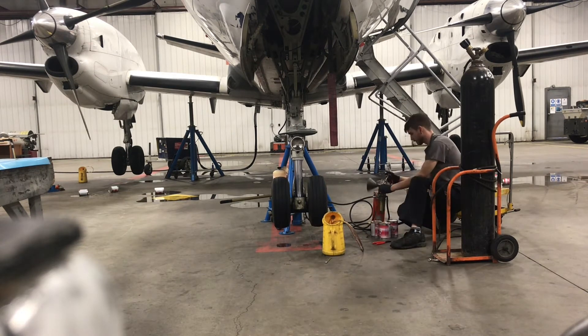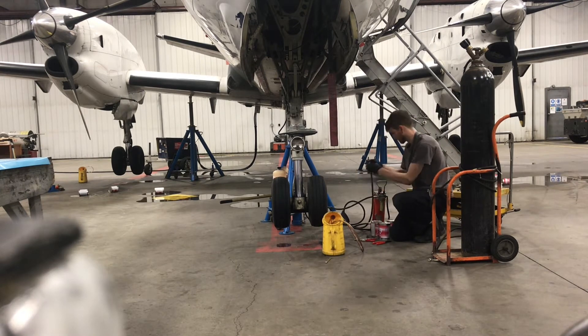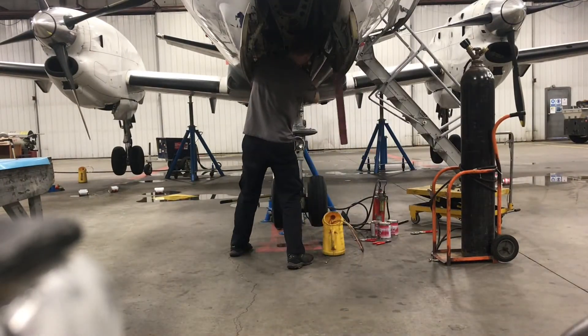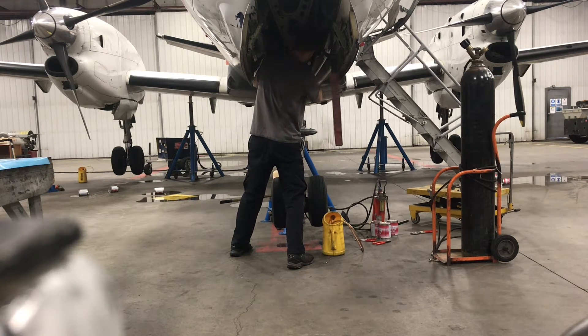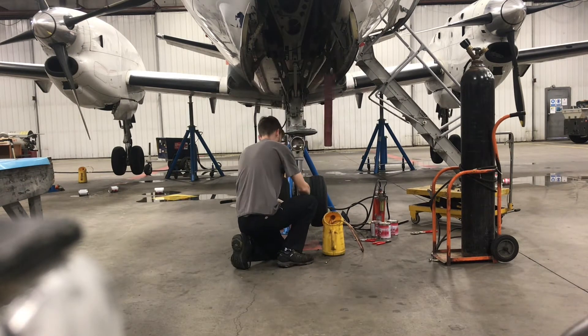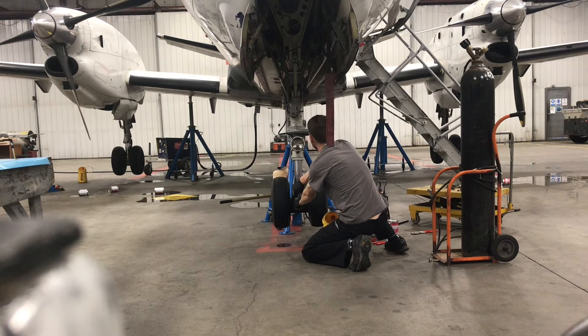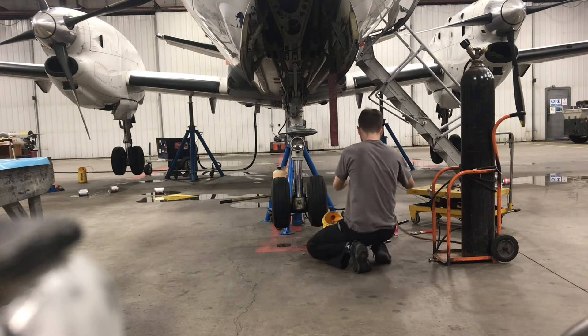Before we go filling it, I need to make sure that the piston is back bottomed. So what I'm doing now is hooking up this little adapter we have right there. I took out one bleed screw, threaded that in, and I'm going to be hooking up the bottle here in a second — but not before I discharge the bottom side. So right now I'm opening up the Schrader valve, letting all the nitrogen out, because the piston is not going to want to go down if there's still air fighting it on the bottom side.